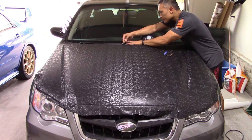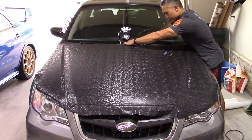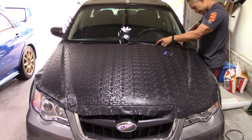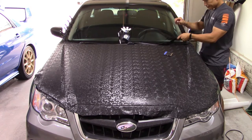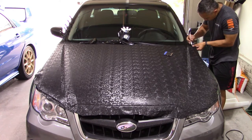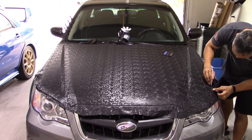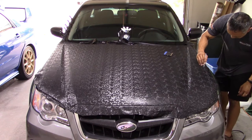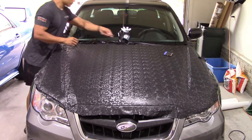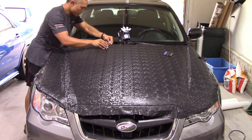Now I'm getting my knife and snapping off a blade so I have a nice fresh sharp edge. Because I rolled the vinyl over, I can put the blade underneath the back side of the hood. I'm using the flat side — the non-cutting side — pressed up against the upper inner side of the hood as my guide, then sliding the blade along the top inner edge of the hood to make a clean cut. For the fender side, the flat side of the blade presses against the inner side of the fender as a guide for a nice clean straight cut.